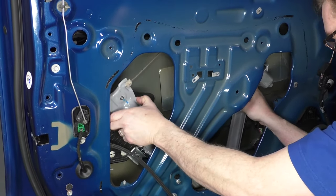Bring the door panel back, plug it in, and turn the key on. Run your regulator up and check to make sure the mount is on there correctly on both sides. Run it right up to the top and now tighten these two clamp bolts. Before putting the water shield back on and the door panel, just test it quickly — make sure it runs nice and smooth and uninterrupted.